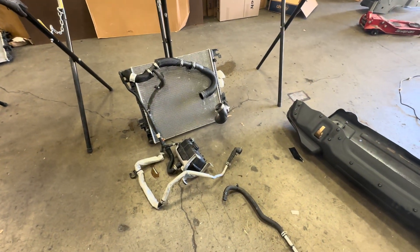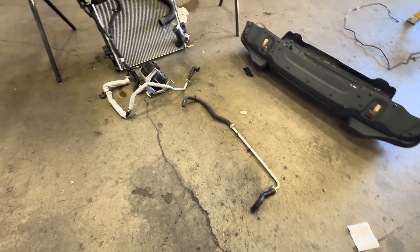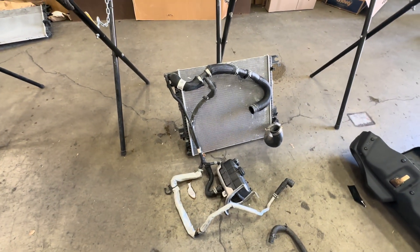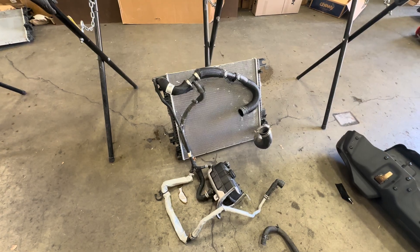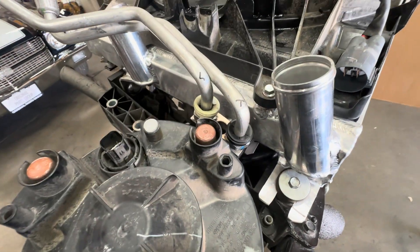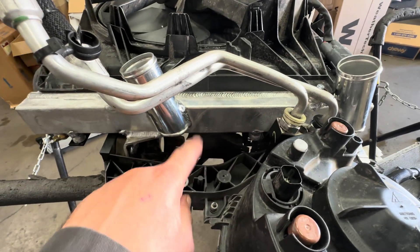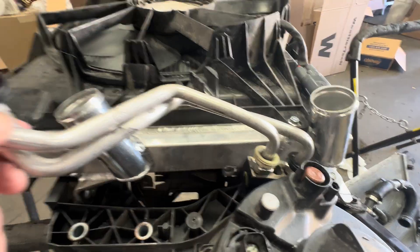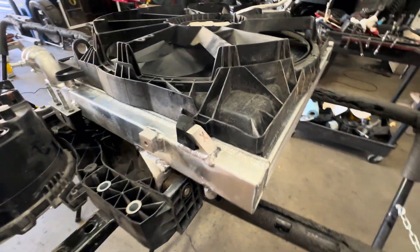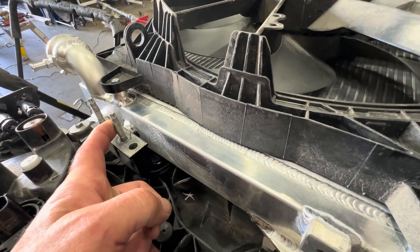So I'm not going to do this radiator setup anymore. Just so everybody knows, this is what you'd have to use if you're going to run this factory radiator — I get it, it's all about money. We did it for about six to eight months and drove it quite a bit. But now I built a radiator. This transmission cooler is actually from the 2-liter — it came from the Jeep when it had a 2-liter, so we're going to reuse that. These are the cooler lines from the 2-liter because the radiator is now about four inches higher. We welded it all up, made it work, and put the AC condenser from the 392 JL — your 3.6 or your 2-liter AC condenser will all work.